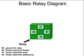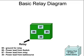Now if you're like me that really doesn't make a lot of sense — I've got to be able to see this stuff for it to make sense. So first we're going to have our battery and use that as an example as our positive battery post or other positive power source. We'll have a line going through that, and with HHO systems we want to have some type of fuse to protect our relay and our system. We'll connect that line up to pin 30, the connector that goes to the relay. So that's the power lead from the battery source.